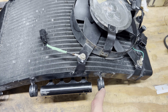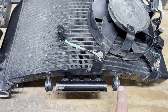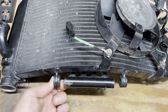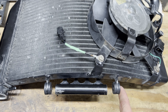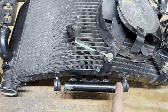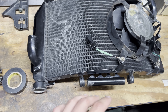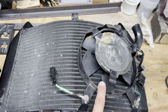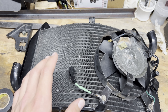Removing the bushings gives you a little more free play when putting the bolt through to mount it and get it to line up straight. I'm using washers of about the same diameter as the bushings on each side. This side has a spacer - you'll see how it looks in the final mounted position, this side's a little different using that new bracket. Washers on each side give it firmer surface area, you have the frame in between, and then the bracket with my own custom spacer to keep everything square.